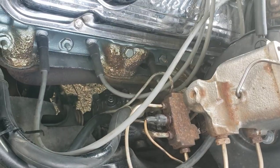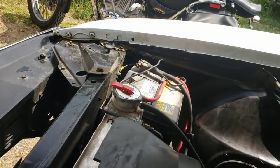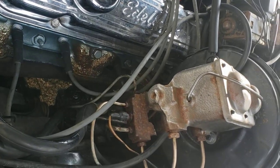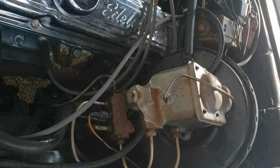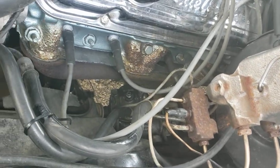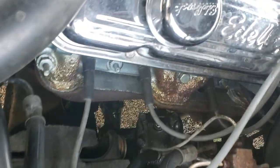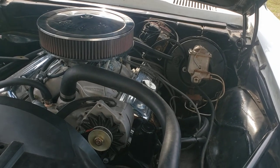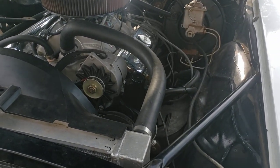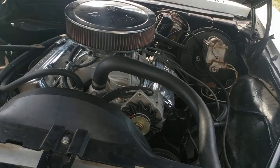I like to go over the cars for leaks because I don't want oils shooting out when you're driving it with fresh paint. Everyone thought the brake fluid was leaking a lot because the steering box was soaking wet, but it turned out it was seeping because someone had redone all the brakes. When they put the lid back on it didn't quite seat right — no big deal, new gasket, cleaned everything up. What we did find is one power steering hose has some rubs in it, and the return line is leaking down there — that's what we were seeing all over the box. We're going to put new lines in. The oil pan has a bit of seepage but nothing significant. We thought we'd have to send it to a shop for a bunch of work, but it turns out it was a battery and some basic maintenance — just use your head.